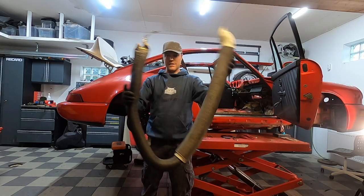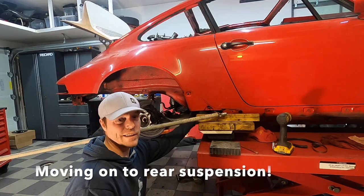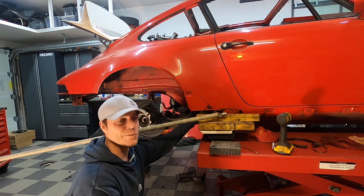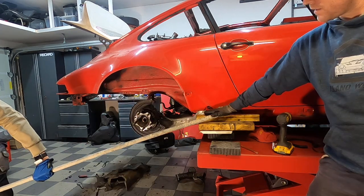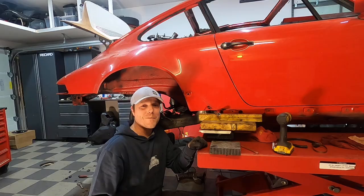As you can see, this is another one of these anacondas that seems to live in this car in various places. We need to release the trailing arm, and it is tight to say the least, so we fabricate a little tool here with a little counter support. Yes — it's loose! When you don't have the proper tools, you fabricate them.